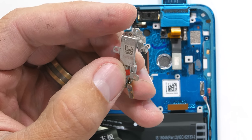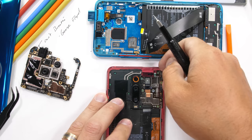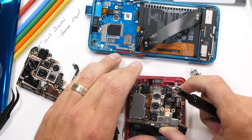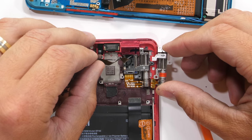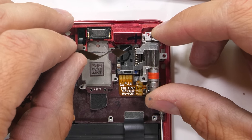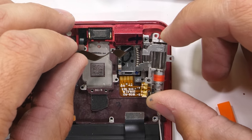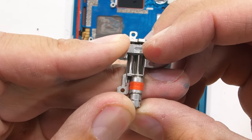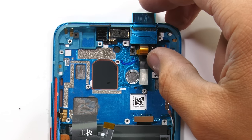It's strange that one little component can cause so much frustration. I thought we might be able to swap the motors with another phone, so I grabbed a K20 Pro from last year, which has the exact same motor size and shape as the Pocophone F2 Pro. But it turns out, after opening up the entire phone, the contact points for this motor are in different spots, which makes them impossible to interchange. Rather unfortunate — we'll just have to see if the selfie camera will still work without the motor installed. The camera does slide up and down freely; it just won't motor anymore.